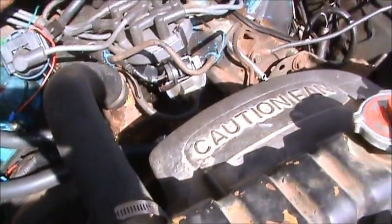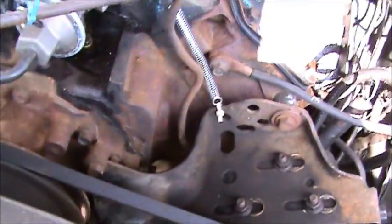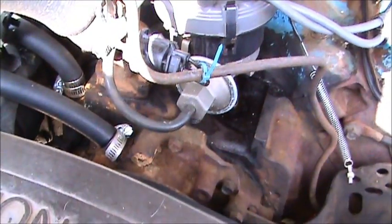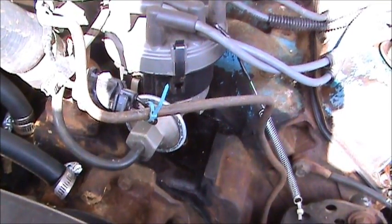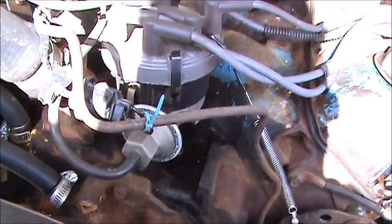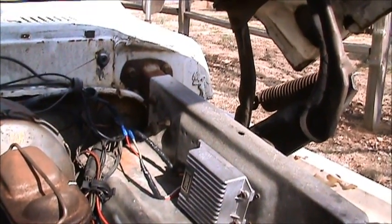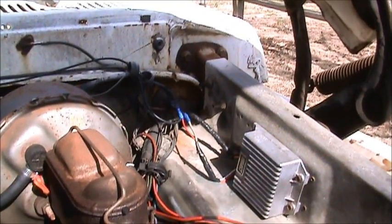Give me a half-inch wrench and a set of wire strippers. All I need is to get that distributor out — take that half-inch hold-down out. Unplug it right there; they've got it hooked to the darn fuel line. That distributor's probably good — I'll keep it as a spare. Brain box over here, it's just a matter of clipping the wires loose on it. You can see where I patched in right there — I did that buck connector with two wires sticking out of it. I did that for a test to see if this thing would work.